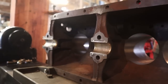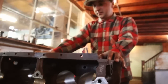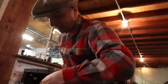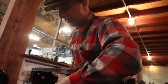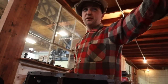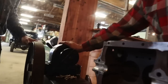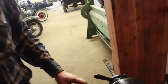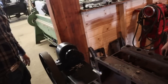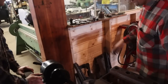You're limited with them originally because they use a reamer. If you don't have the reamer for the right size, you can't do it. So we're trying this. It's the first time that Dad made this special cutter that hopefully will make it so you can use a single point cutter on this. You can use a single point cutter on that style because it feeds hydraulically and you can adjust. The speed is not coupled to the RPM, because this feeds the thread. If you could feed this slower, then that'd be a pretty fine thread. It's still a little too fast. It cuts that thread. But that's why you've made these big flat cutters. Dad made these for us, so we're gonna give that a spin.